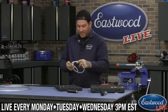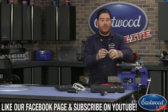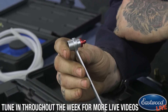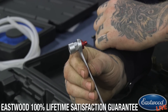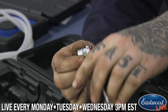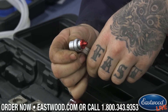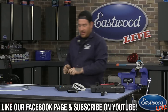A viewer question about the brake bleeder: it looks like the nut can't come free from the wrench so you can't lose it — is that true? Yes — the bleeder piece built into the wrench has a little lip on it that stops it from falling through. So if you're working in the shop and things get messy, it's not going to fall out. It also gives you a ratcheting effect to loosen as needed — you're only going to be turning it a quarter or half turn to break it loose, but you have the option to loosen more. It will not fall off because of that lip.